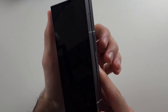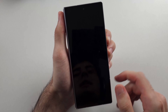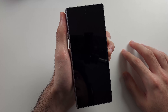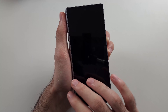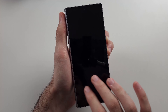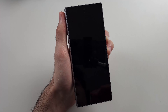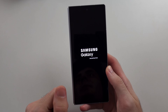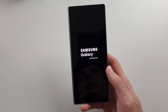All we need to do is press and hold both power and volume down. I'm going to press these now and keep them held down for around 45 to 50 seconds. The phone may actually be on right now but the software glitched, which is why it's not responding. We'll patiently wait for the Samsung logo, and once we see it we can release — the phone will turn back on.